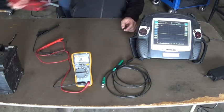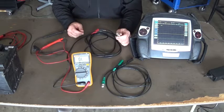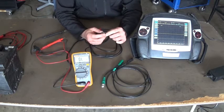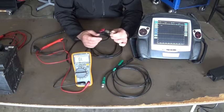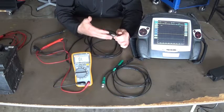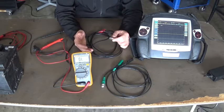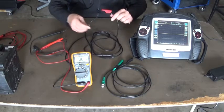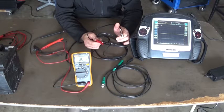Now, common problems. Especially on cheap type test leads like this one I got off eBay — what can happen is that the BNC connector gets loose. When you connect the test lead to your circuit and things move around, you are going to lose continuity and see a dropout on your signal. You might think you have a dropout from, say, a cam or crankshaft sensor, but it is actually inside your lead. This is a lead I used last year and it messed me up big time, so I cut the end off. I don't want to use it anymore.